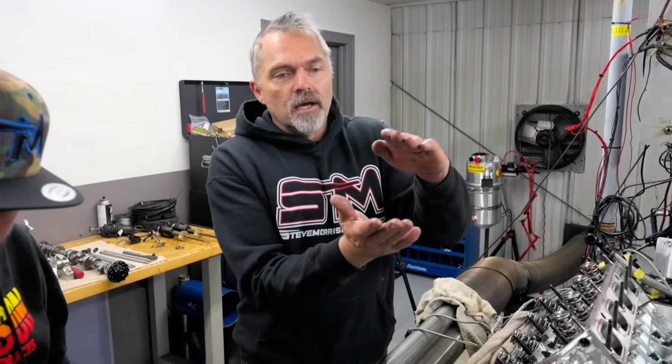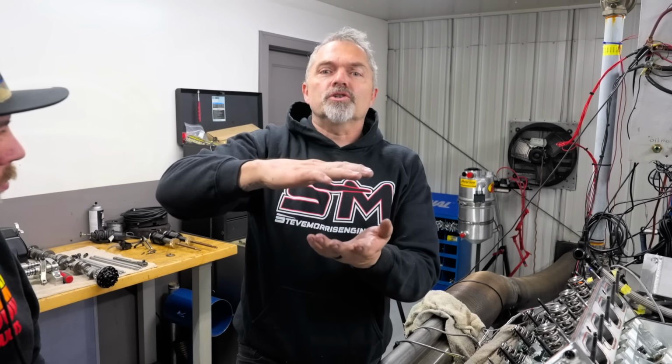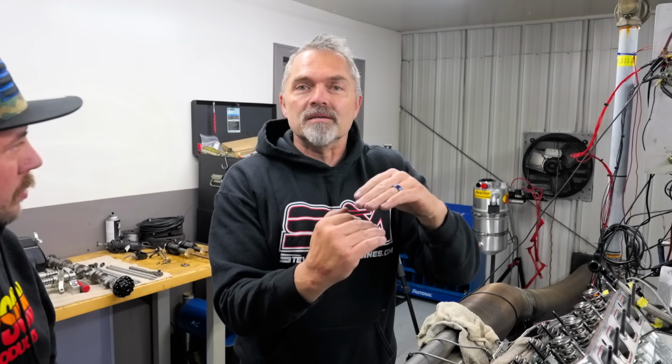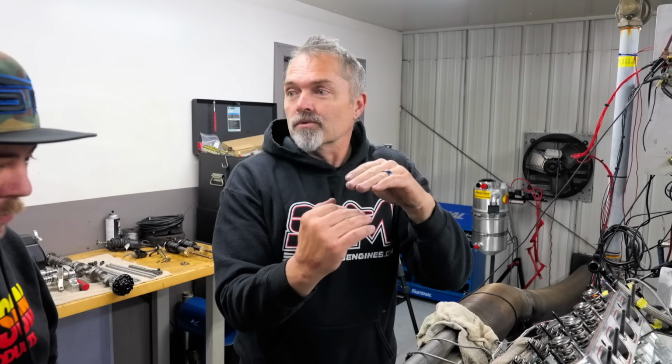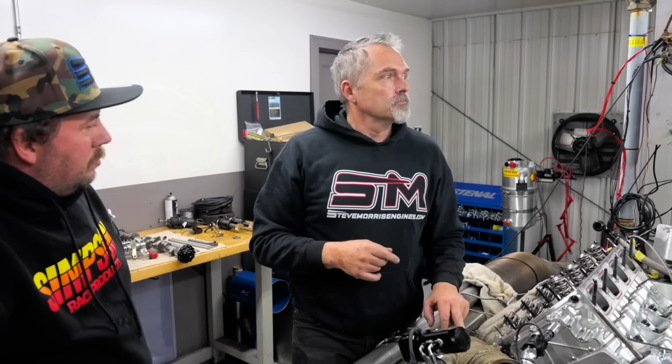So another real common question, I can't show you, but you have to revert back to the clip. I thought this was a really interesting thing. You could see during the first pull of this engine where the inlet sucked shut. A lot of people jumped on there with a partial truth, but they're not thinking about the whole thing: it's ambient pressure. You put a vacuum in it and ambient pressure crushed it. Okay, that's part way. Ambient pressure is 14.5 pounds, right? But I showed you that in order to move it the same distance that we saw it move, it took almost 60 pounds of pressure. I was literally on a scale pushing it, trying to crush it. It took 60 pounds of pressure. So it's more than just the ambient pressure. That makes sense?